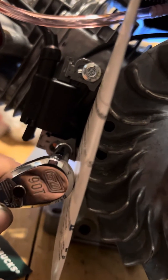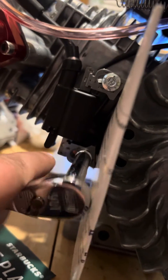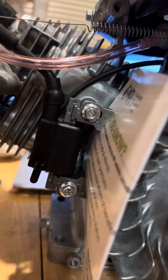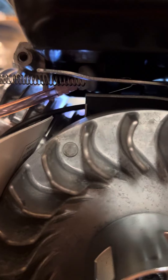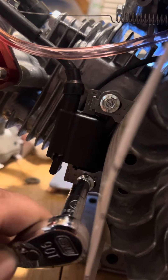Loosen the nuts up on the coil — we'll use this gear wrench ratchet and socket. It will suck itself right down onto the flywheel, right down onto the magnets, and that paper will conform better than a steel feeler gauge. So now the magnets are sucking that thing down and we know they're 30 thousandths away from that flywheel. If this was a billet, we'd run a little more clearance, but 30 is good.